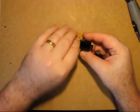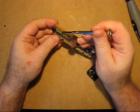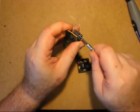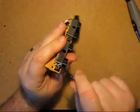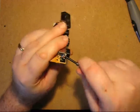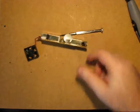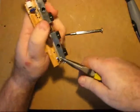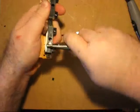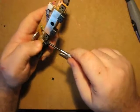In this case, the Dreamcast again. First thing, remove that — it's not needed. You're then back in the situation where the grounding strip is connected to the board. This won't be soldered in overly brilliantly, so get rid of the grounding. Put your screwdriver in — don't be too scared with this. What you want to do is effectively lift this off. That's when we need a little bit more force — wiggle it out. Now we've exposed one corner. Now use your pliers, because you want to lift off this grounding.